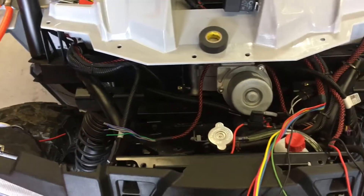My plan is to get all wiring run. I've got wire in for the light bar going up in here. I'll run wires to the two light pods in the front bumper and the two light pods on the door latches. Once that's done, I'll also run wire to the rear for backup lights with the turn signals and an additional wire for the CVT fan.